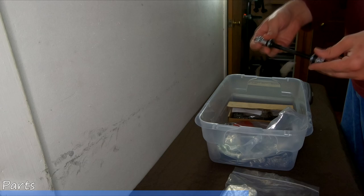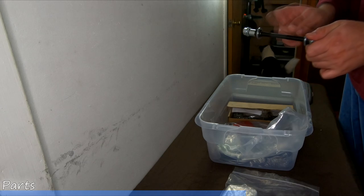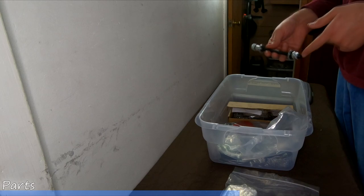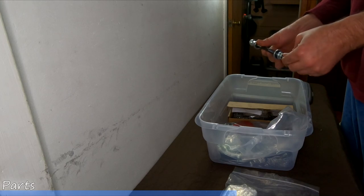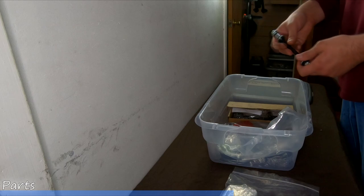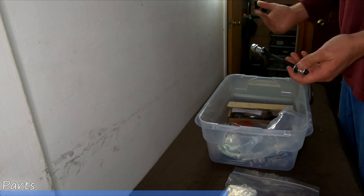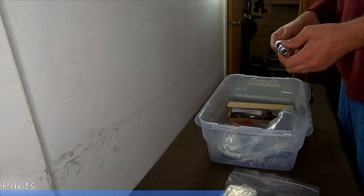Fresh axles. Probably a good idea for you guys to keep a spare rear axle on hand. I haven't had issues breaking axles, but I have had issues stripping the threads. Generally, you torque these down a little harder than you should, or at least I do, to keep the rear wheel from moving under the hammering load of the motor.